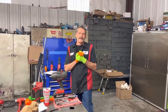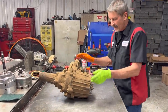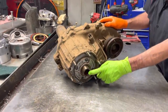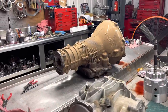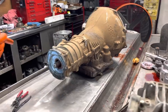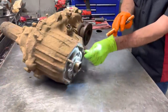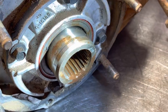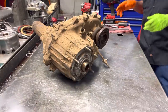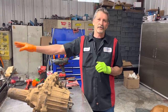We've got Mr. Jason Duffy's 96 Dodge 12 valve in the house today. It's got a 241 DLD transfer case. It's got the splines almost stripped out in the front where the transmission slides in and attaches. And then the transmission output shaft coming out of the overdrive section is almost stripped too. You can see this shaft here is almost totally stripped. We've got all the billet shafts in the house. We're going to do the transfer case first and tear it down, then do the video on the transmission. We've got a lot of cool stuff going in this thing.